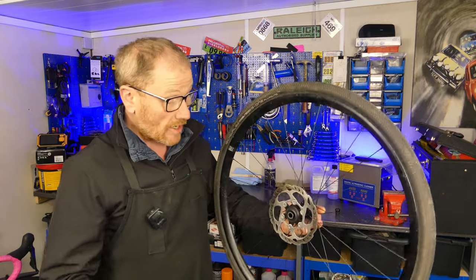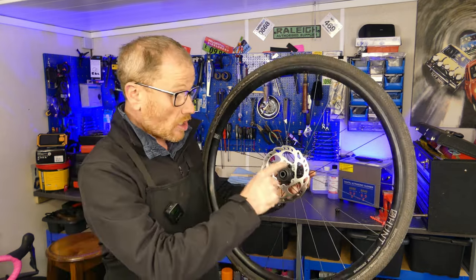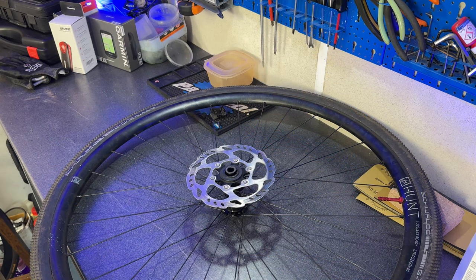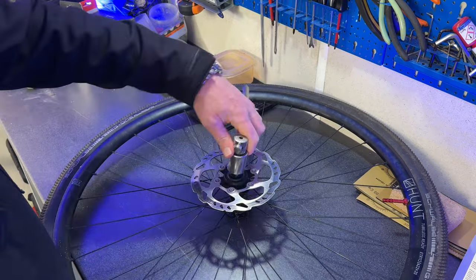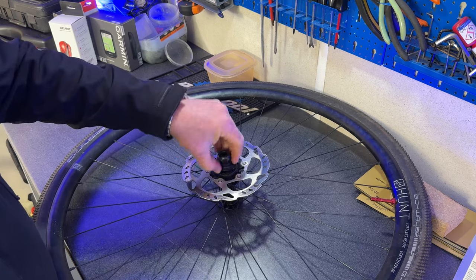So that's my wheel and my pads removed from the bike, and the first job is to deal with the rotor. In my case I'm going to be removing my rotor from my wheel — it's a little bit easier to do this job with the rotor removed, and it's a lot easier for me to demonstrate. If you want to remove your rotor and it's bolted to the hub with six bolts, you're going to need a torque wrench to torque it back down, otherwise it will wobble. So only remove your rotor if you've got the correct tools to put it back on. Centre lock disc removal is quick and easy using the right tools — pop your disc removal tool in a large spanner and literally crank it undone. Quick and easy.